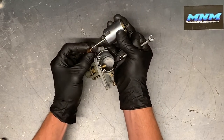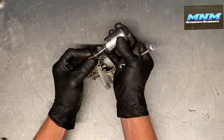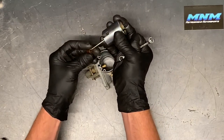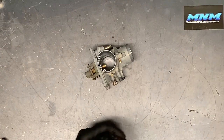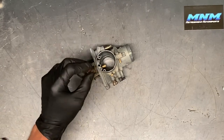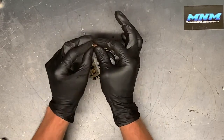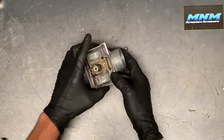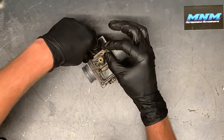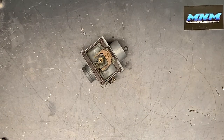If you have a longer needle, the slide has to open more before fuel can come up through the carburetor and into the cylinder. If you have questions on that, leave them in the comments below — it's hard to picture without actual fuel running through there. There is also a brass washer underneath your main jet, so make sure that goes back in that order. To clean it, blow through with compressed air — carb choke cleaner is also good — make sure there's no debris and it's not gummed up.